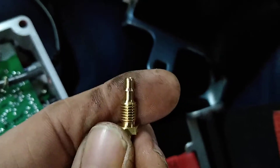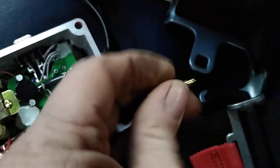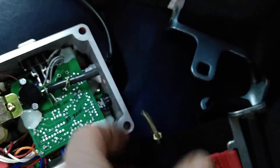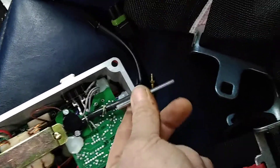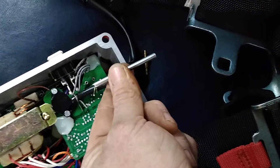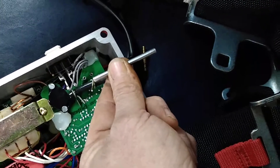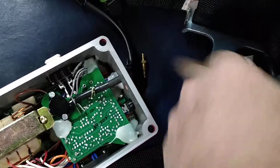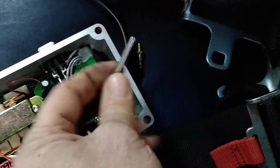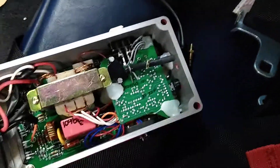You're paying $550 for this thing and you get this little cheesy piece of crap in there. I'm going to put this steel line in there and I guarantee you — I already put it in my hose — you can't pull it off, you'd have to cut the hose to get it out. Then I'll just take a little rubber grommet in the hole over here if I can find one small enough, if not I'll just dab a little RTV over it and call it done. That's just poor engineering on that part.